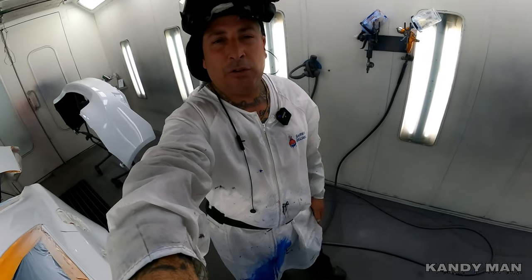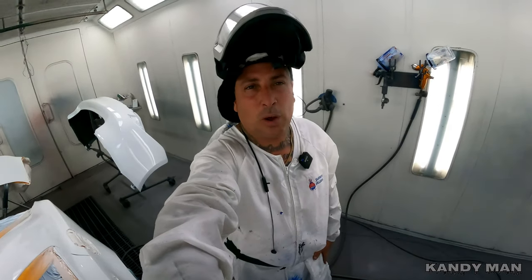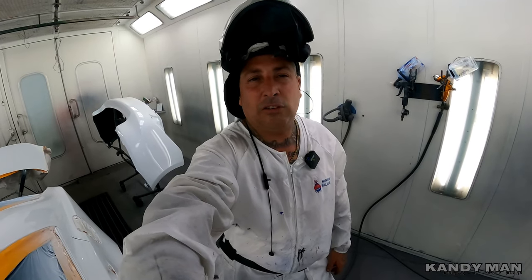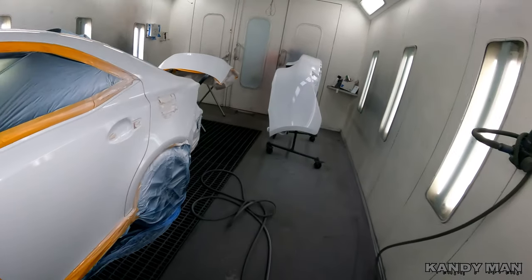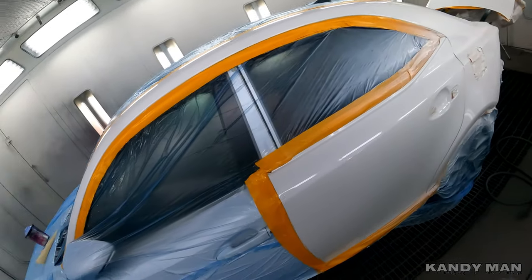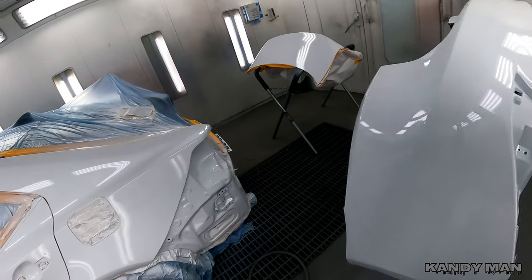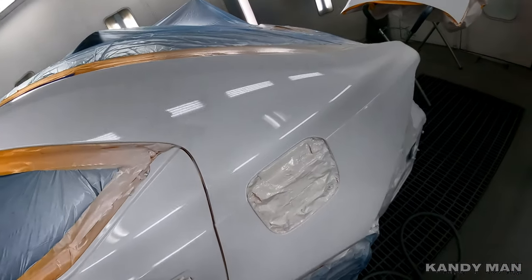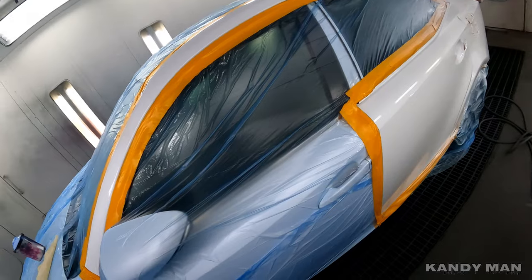That's one coat of clear. I'm using the CC200 with the UH-90 hardener, and I went up one step on the reducer to a slower temp in this weather. The whole rest of the year I use the US-4, which is a slow reducer too, but in real hot weather like this I go to the US-5, one step up. We're using the Tecna clear coat gun, spraying at normal 24 PSI for the clear. It breaks up nice and even with this reducer. This gun is kind of a hoser compared to my DV-1 that I'm used to, so we have to be a little more careful, but it's hotter out so it works. Let's finish it up.